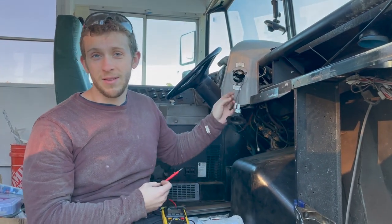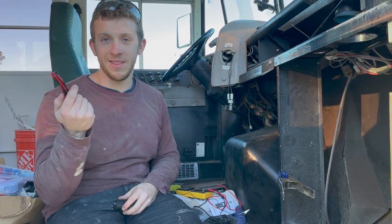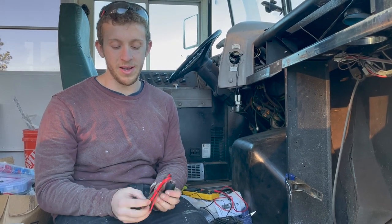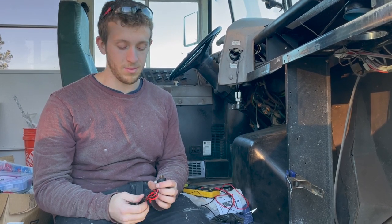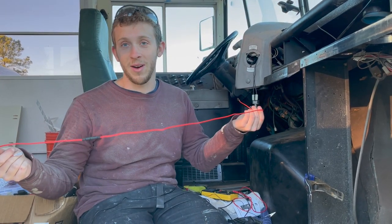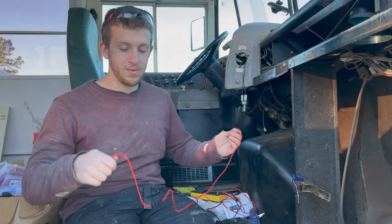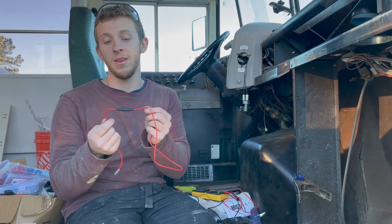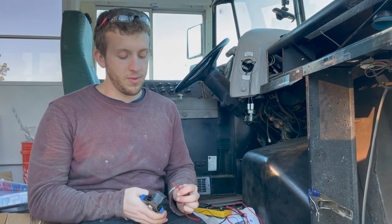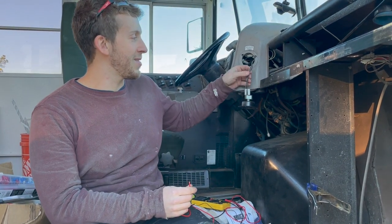Now it's pretty straightforward - I'm going to connect this wire to this one, which already has an inline 10-amp fuse. In our bus this wire is black but it's actually a hot wire - normally red is hot in DC, but it doesn't matter. The fuse has to go on the line that's actually getting the electricity, the positive side. This has a ring terminal on it that I don't want, so I'll cut it and strip the wire a little bit.